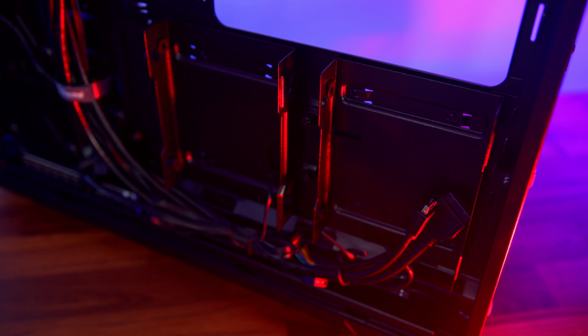Back to those who may be looking at water cooling in this case, you'll be pleased to see the inclusion of a fill port in both 21mm and 25.4mm sizes at the top of the case, but sadly no drain port at the bottom. But that's nothing a step drill bit and a piece of sandpaper can't fix, though I'm probably being a little bit overcritical here. For storage, there's space behind the motherboard tray for 2 3.5-inch hard drives, though if wanting to install SSDs here, you will need some kind of an adapter.